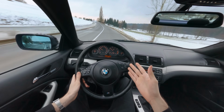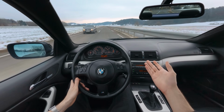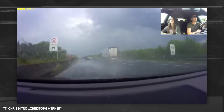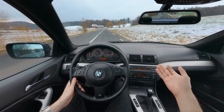And now, good tires. It's literally where the rubber meets the road. I really wouldn't cheap out here. Get a quality set of performance street tires. I wouldn't go for semi-slicks, since those are usually very bad in the rain. Plus, they kinda need to heat up properly before they start working. Plus, they can wear out pretty fast, but that really depends on the tire make and model.